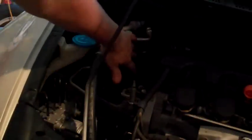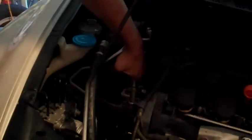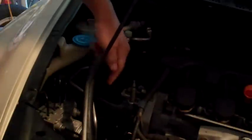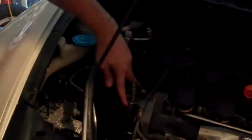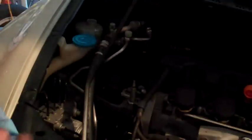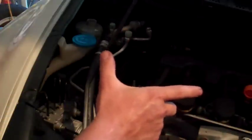Now that you've got that pulley off the water pump, the next step is to remove this motor mount. There's one bolt here and two bolts here to remove, and this big rubber block will come out. Once that block is out, there's one bolt underneath that holds the aluminum piece in place, and then you've got to remove two more bolts and pull this whole aluminum triangle out. Before you do this, you need to support the engine — grab your jack, put it toward the rear of the engine with a piece of 2x4 underneath the oil pan, and relieve the weight off that motor mount before disassembly.